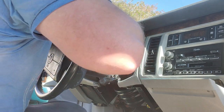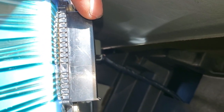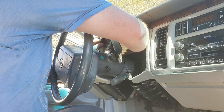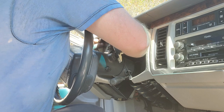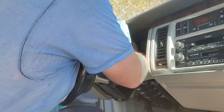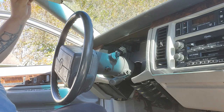Now we're going to reach back and unplug the wiring harness. You can see that little plug back there - we have to unplug that because that's what's keeping it in. There's a wire and this plug that actually plugs into the dashboard itself. You just have to squeeze and pull. I was squeezing the wrong way - the clip is up and down, not left to right. Almost got it - there we go. Now just tilt it forward and pull it out.